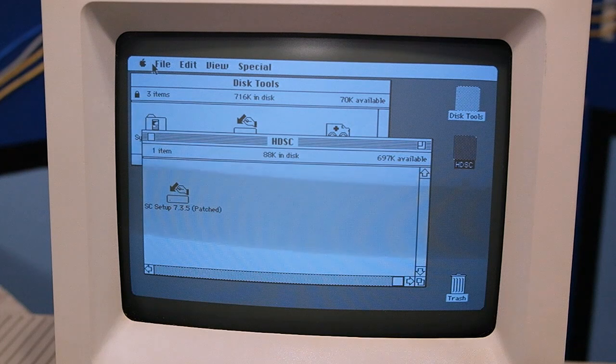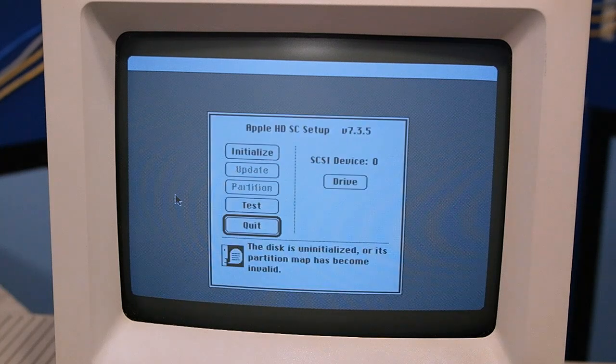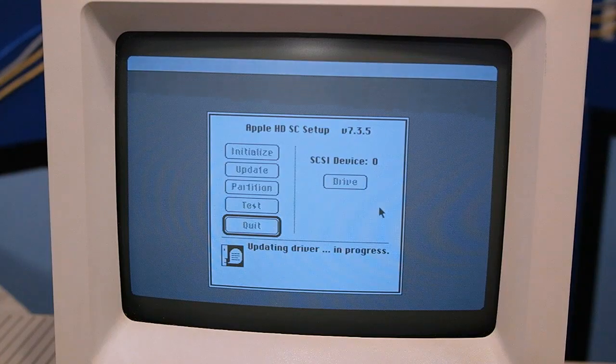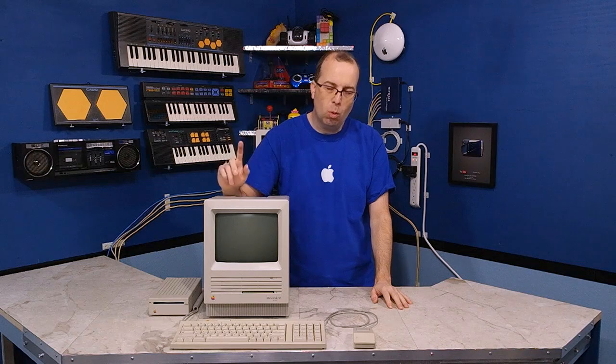I have the SD program on a second floppy using an external drive. It requires a modified version of this software because the version Apple supplied at the time will only recognize Apple-branded SCSI drives. I've used this patched version on many generic drives in the past and never had an issue. The LED I wired up is working. However, I kept getting an error message when it tried to write to the disk. Like always, these sorts of projects don't always go to plan.